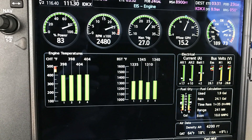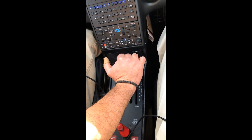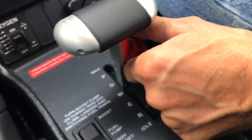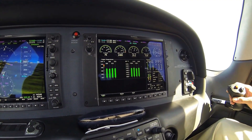From an operations perspective, the engine is really easy to operate. The engine page shows all cylinder head temperatures, exhaust gas temperatures, fuel flows, and everything. From a leaning perspective, you take off and climb with full rich mixture and full forward throttle. When you get to cruise — very much like the SR-22T — there's a fuel optimization caret. You bring the throttle back to about 2,500 RPM, then simply pull the mixture lever back until the pointer is at that fuel optimization caret, giving you the ideal best-economy fuel flow without having to go through the whole lean-assist procedure.